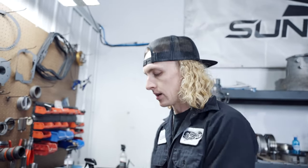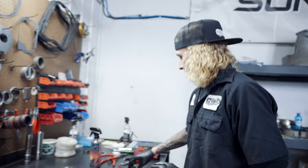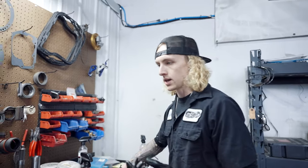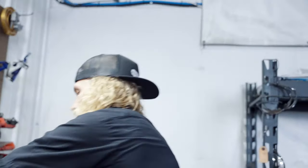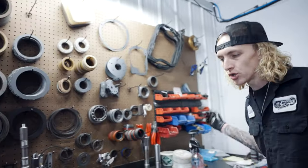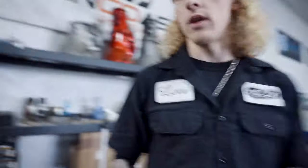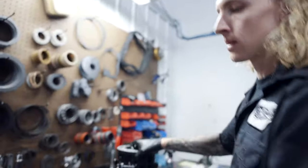Tool is out. So your alignment tool essentially allows you to drop in your planetary drive, and we'll show you the assembly process in the next video. So that right there is essentially the assembly on the three most important factors on a 48, forwards: your directs, your intermediate planetary tolerance, and your overdrive, which we measure when I do the overdrive section. Let me do the overdrive section for you guys really quick.